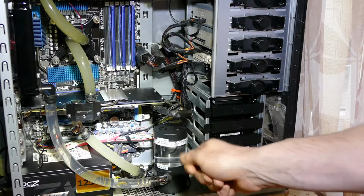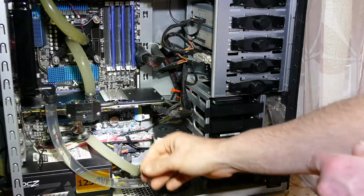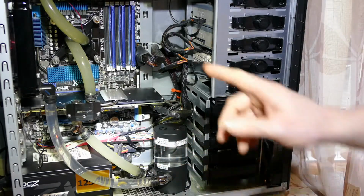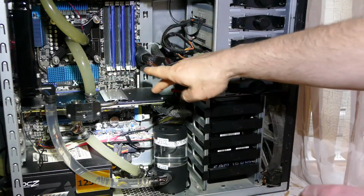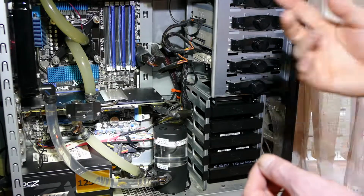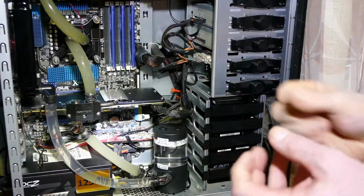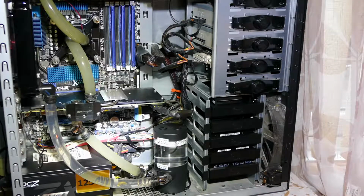When you're sitting, you have a wee look and just make sure there are no drips, because when that water heats up, everything increases in size, it expands. Now it's only very, very slightly, granted, but everything expands. The pipework, the fittings, the copper, the metal, everything expands. So when it's running at ambient temperature, if it doesn't leak within 20 minutes, it's not going to leak. But when everything moves and expands slightly, it may leak. So run it hot as well.